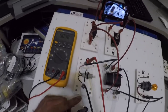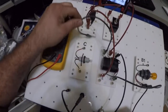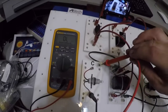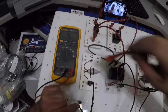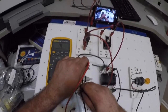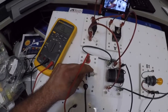Okay, to verify my concern, I'm going to measure resistance. Now remember, you have to isolate the load in the circuit before you can measure resistance. So I'm going to take this out and take this out. We've already tested voltage drops on the ground, on the power wire and the black wire, and they both tested good. I'm going to come in here, move my meter to measure resistance, and I'm going to stick my lead up here. Now, if this bulb is good, I should get a low ohms resistance, right? I don't. I get OL. I'm playing with my leads, making sure everything is good. There's nothing that's going to counteract my reading, but I'm still getting OL, which means since this is isolated, the only thing in this circuit is this bulb. I'm not getting any voltage through my bulb.